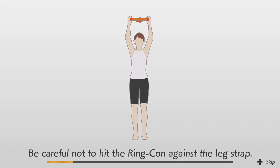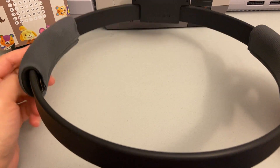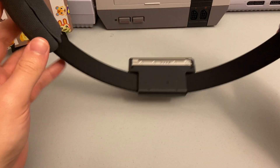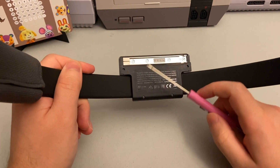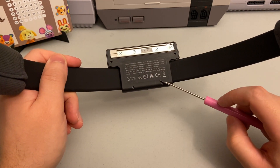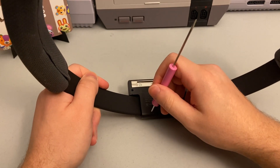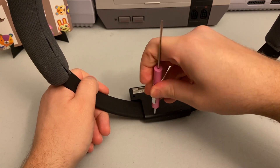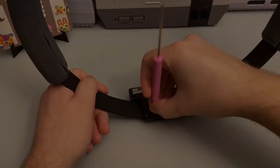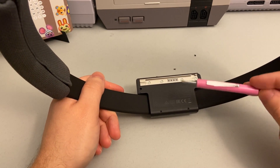Now the Ring-Con is literally just a Pilates ring with a Joy-Con attached, but it's not the peripheral alone that gets you sweating — it's the combination of the Ring-Con and the game that makes it truly great. Let's move on to the internals of the Ring-Con. To get this thing open, we first have to remove four small black Phillips-head screws found around the plastic portion of the underside of the Ring-Con. It's pretty interesting that Nintendo went with Phillips-head screws here, as it makes it very easy for your average user to open — usually we'd expect tri-point or game-bit screws on a peripheral like this to make it harder to open.